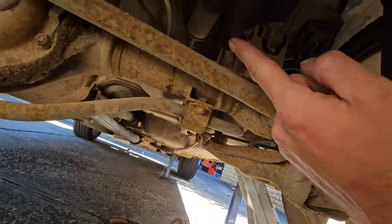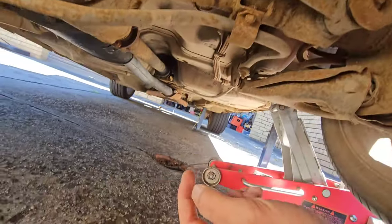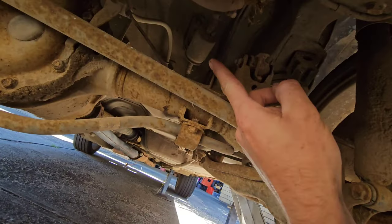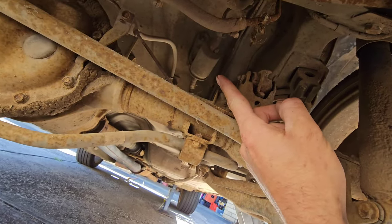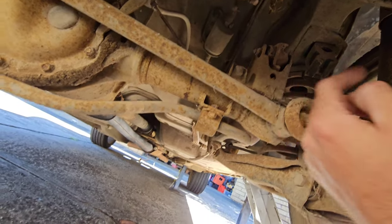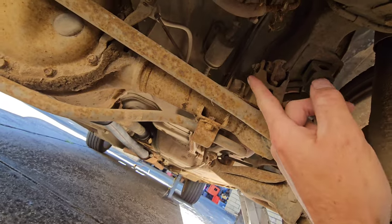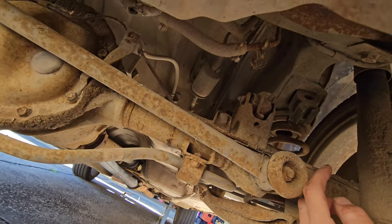And look, when we get the old fuel filter out, what we do is get a plastic container, something I always did in the workshop. We give it a bit of a knock on the ground, and then we blow it out backwards, and we see just how dirty it is. And I tell you what, with the state of the car and everything else, that is going to be filthy. So let's get started, let's have a look.